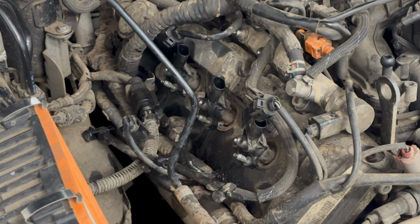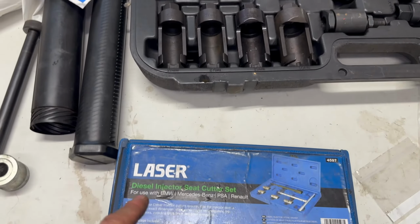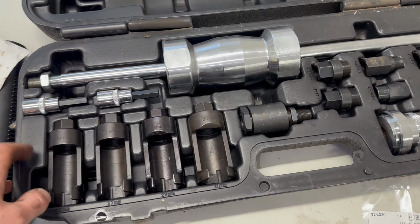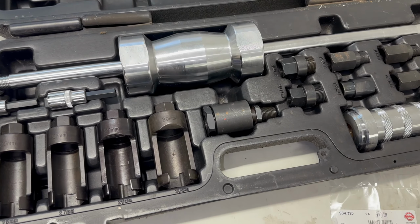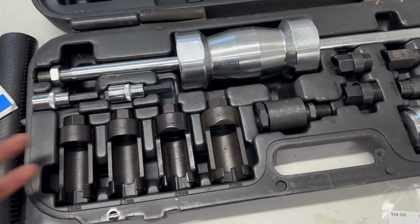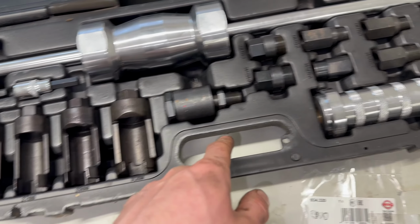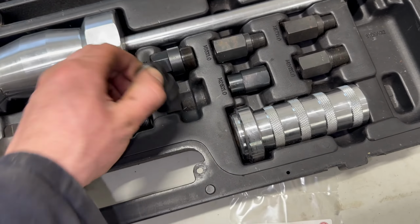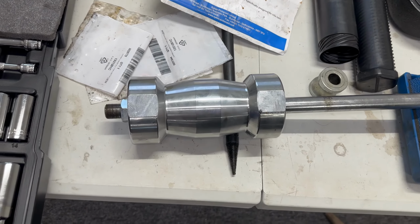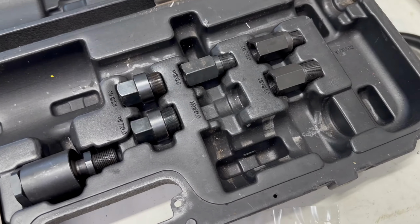So, I've got with me a reverse hammer, which I'm going to assemble. The tools that I've got here, bar my normal toolkit, are borrowed from Motec in Gould, so thanks to Jeff for letting me borrow these again. I don't know what the correct name for them is, but it's a sort of reverse hammer. So you assemble this, connect it to the injector using the correct fitting, whichever one will screw on the end of the injector. So this fitting that goes on the injector, it's the only one that seems to work this way around.